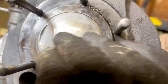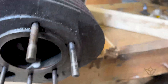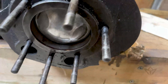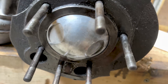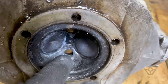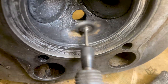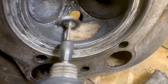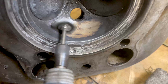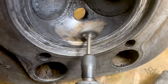That's much improved. The sleeve shows no sign of any scarring. We just keep that lubricated as we work on the other parts — I don't want any of it rusting. There's no play in that piston whatsoever; it feels really nice and tight. The head is full of carbon, so we use a brass Dremel to slowly clear the carbon off. I also pour petrol down the back of both valves to see if there's any leaking, to determine whether I have to take them out or not, because leaking would mean the seating is releasing pressure.